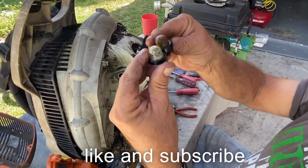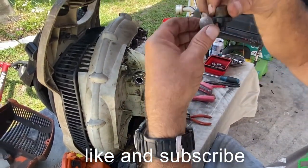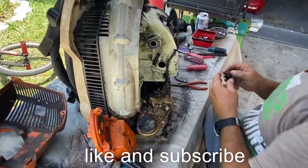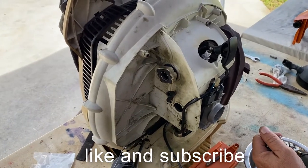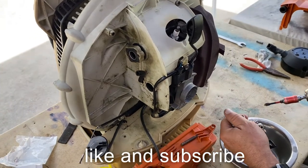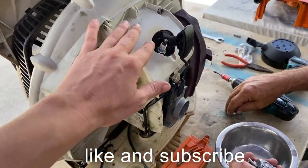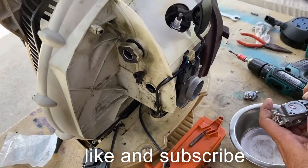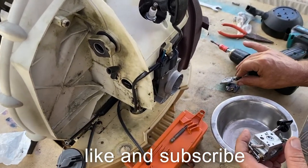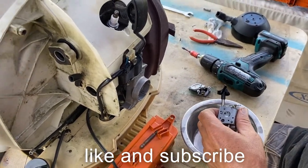Let's see if we can match one of these up. It looks like we're going to have to go to the store for this. So after cleaning everything up, we realized the carburetor needed to be cleaned up majorly. We cleaned the flywheel and the magneto. We're right now about to replace the primer ball, take care of a few more things, and then we'll be pretty much done. We'll catch up with you when we're done cleaning up the carburetor.